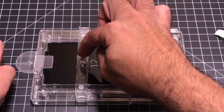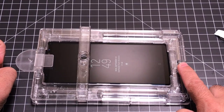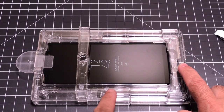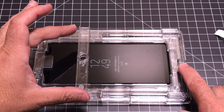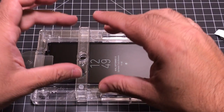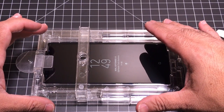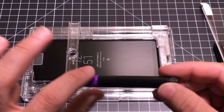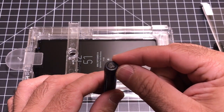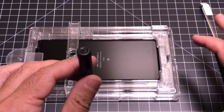On your tray you have an arrow on each side. Once the liquid is on the screen, we're going to press down slightly to tilt it. You notice how it tilts? Once the liquid moves from its position and reaches the center area past this line, you'll see the bubble move over. We then remove the pin, the glass comes down, and we wait 80 seconds to let the pressure of the glass dispersing the adhesive evenly. Now, taking a look at the adhesive bottle — once you have it in place and tightened, remove the top. Once you unscrew the top, air comes in and allows the liquid to disperse.